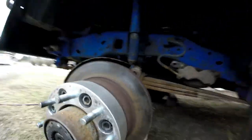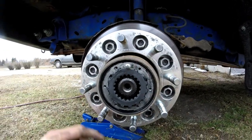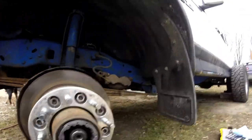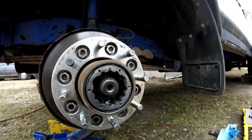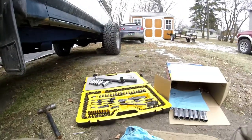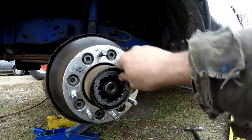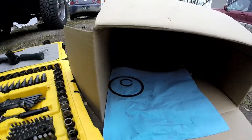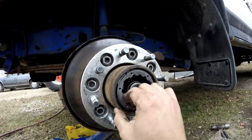It mounts here and here. Now do that little screw there and take out the spline assembly. When you got the outside cover off and the spline gear, there's a ring around the entire thing — take that off to get to the inner one. All you do to get this ring out is take a small screwdriver to pry it out carefully. Take a nice little spin around, take it out like a lock ring. I took out that little clip, so now the whole thing just slides right out.